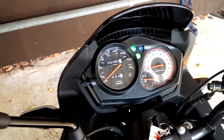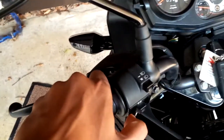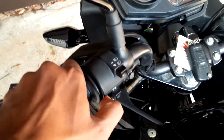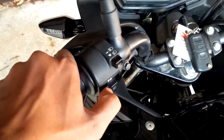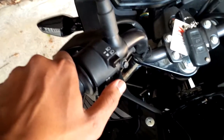I thought at least the indicator relay was the problem, because the switch seemed fine. I sprayed WD-40 into the switch to make sure there's no contact issue, and then I thought the problem was with the indicator relay. The indicator relay is right in there.